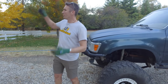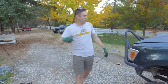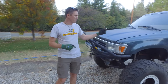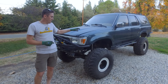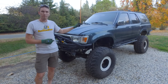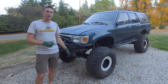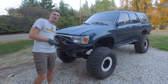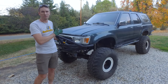After you're anchored to your big, heavy Ford at the other end of the yard and everything is set up, we're going to reel this in under weight. Turn the engine on so we can power the winch and keep the battery full, then hold the brakes as we let the winch pull the vehicle in. While we're doing that, our camera guy is going to make sure the line is spooling properly and not getting bound up on one side — spooling left to right, left to right, over and over.